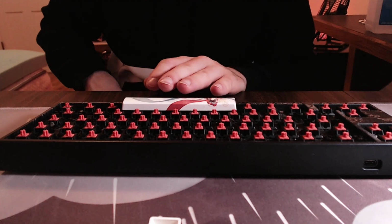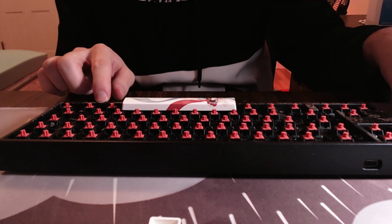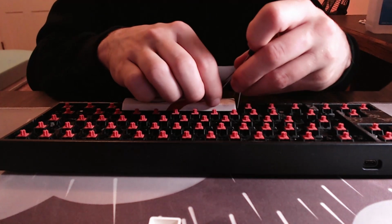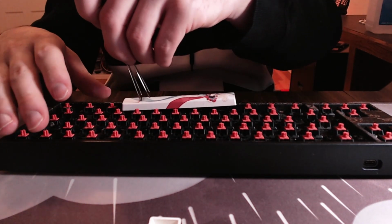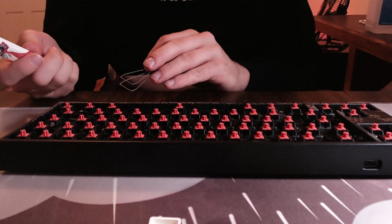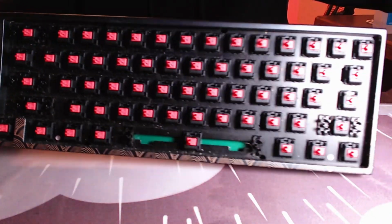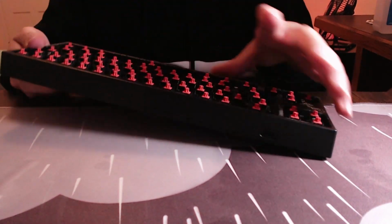If you've never taken apart your keyboard before, and you get to the space bar here, and you're like, oh, this doesn't stretch wide enough to grab it. All you have to do is go under there, and then you'll just give a tug on the other side. You can just give it a little tug, and that comes off. This is really just connected by three things. Yeah, you can kind of see all the hairs and stuff. So it's always good to clean your keyboard, yeah?